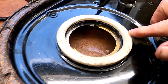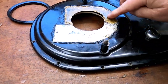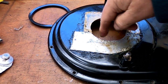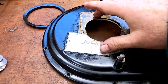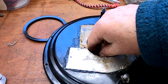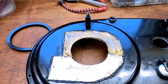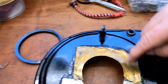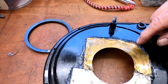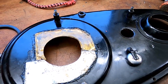I'll just have to put all this back together. Many years ago I stuck some thin pieces of metal — a bit of brass, a bit of aluminium — and put a hole here to reduce the diameter as much as possible, to ensure there's only scope for the clutch parts to stick through, as further restraint for any oil likely to escape. On this occasion the oil leak was catastrophic — it was just coming down here, running along and falling off the casing and making a mess onto the bike, which is completely unacceptable.